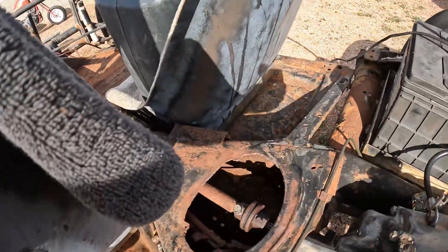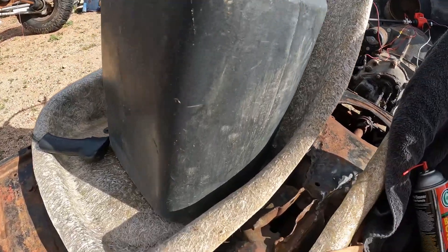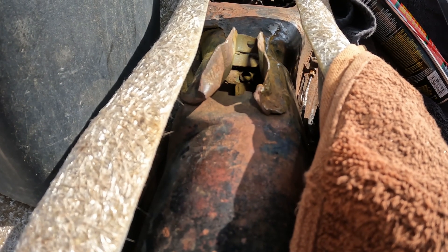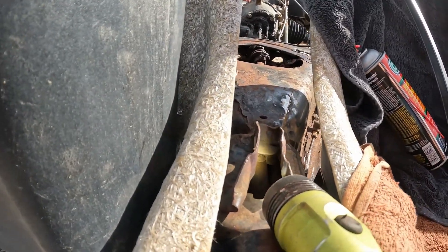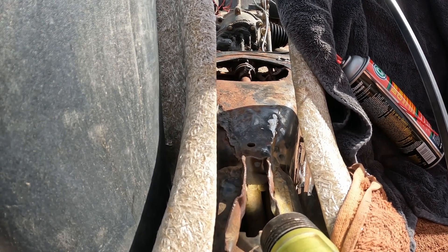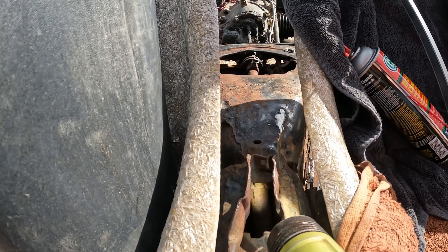I got that screw set in there at the proper location and I'm not getting any rotation at all. I look down in here — that right there, the tube is dragging so heavily on whatever that thing is. That must have been for the cables of the emergency brake. So I am going to have to pull these seats out, cut the top of this tunnel off, and clean that up — that's the only way I'm going to get this shifter to work.